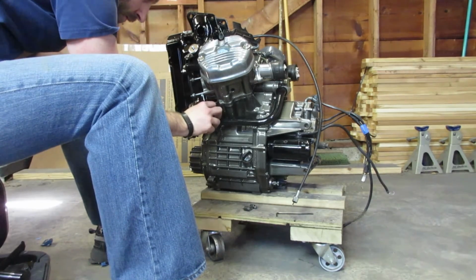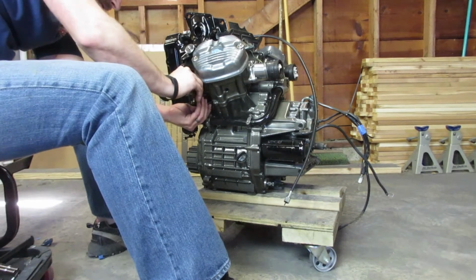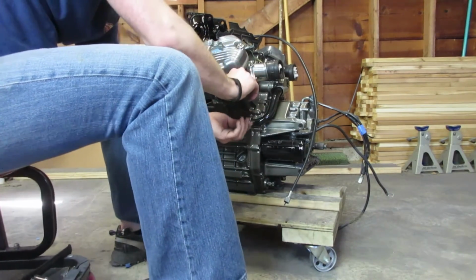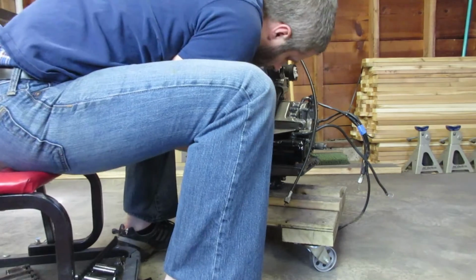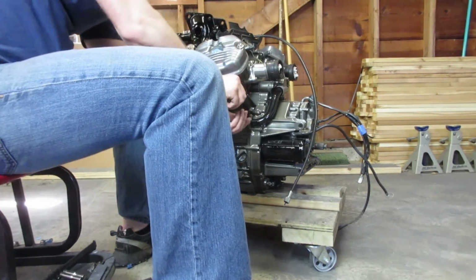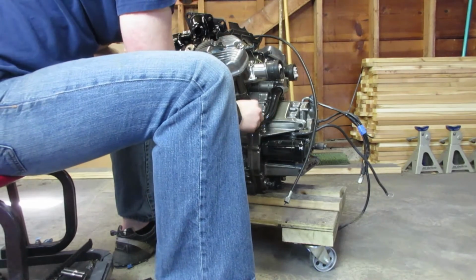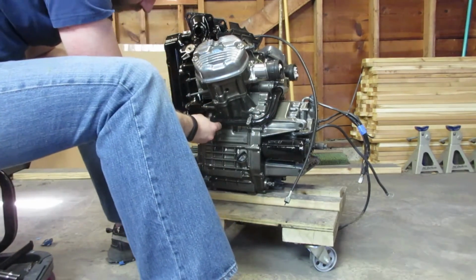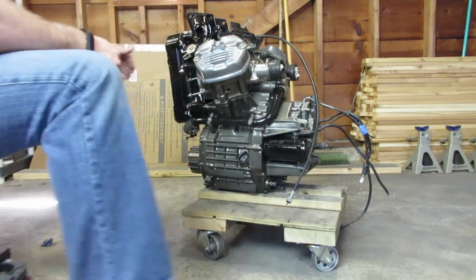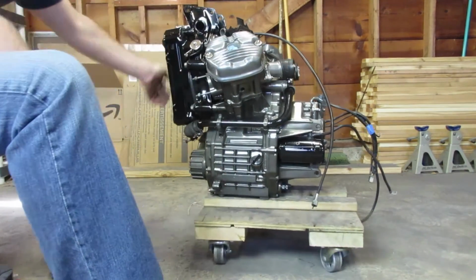Now I'm going by the book on this one to keep this pipe from leaking. I've got a new O-ring, I'm clamping down the pipe accordingly, and I'm making sure that the pipe is straight aligned inside the water pump. But I have seen occasions where this thing will still leak initially on starting the engine, and can leak from time to time during operation in the future.